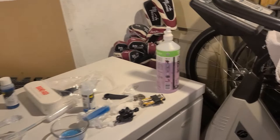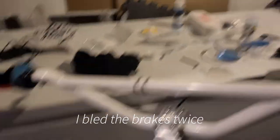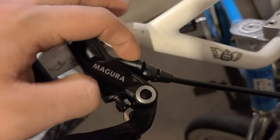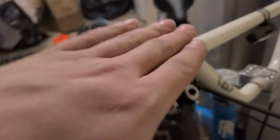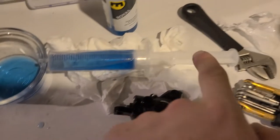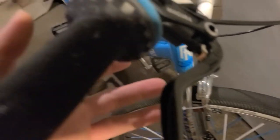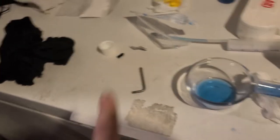That was quite the process. I bled the brakes twice and they didn't work because there was too much air in the system. I did a quick bleed from just the brake lever — I put the syringe right into the bleed port, put the brake lever like this, and basically snapped the lever and let the air bubbles go out. I moved the plunger back and forth and let the air go. Did that for about five minutes and now they feel quite nice.